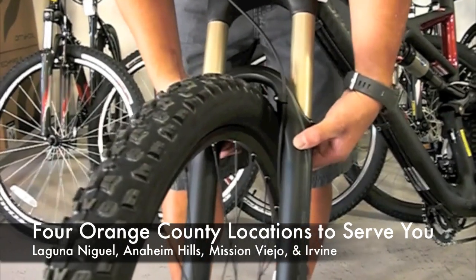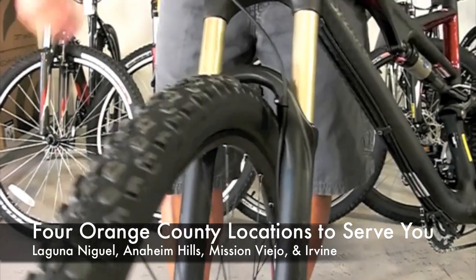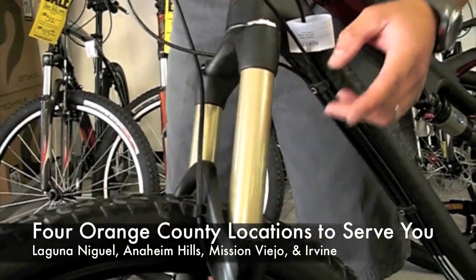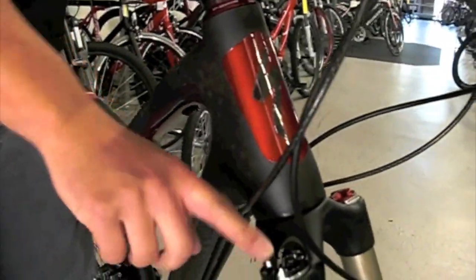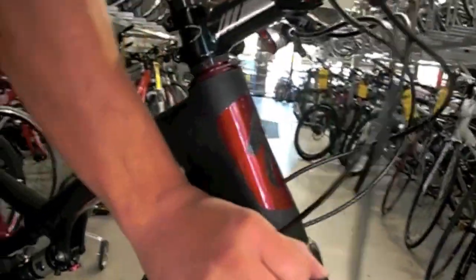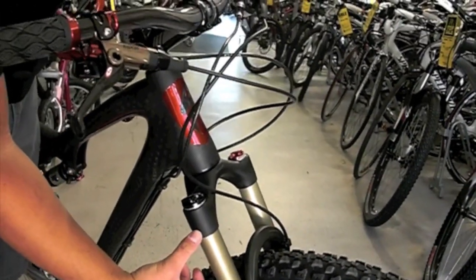The next best thing is the fork. This is a brand new feature shock fork from Specialized called the S140TA. What that means is you're getting 140 millimeters of travel with a travel adjust feature. There's a dial up top on the right — you can hit short by turning that lever and compressing it, and now you've got 115 millimeters of travel.